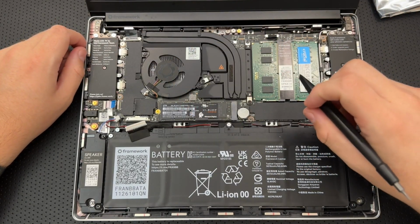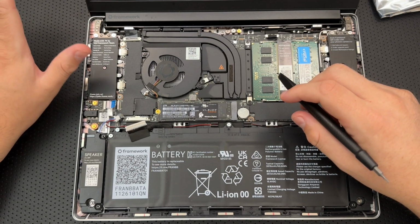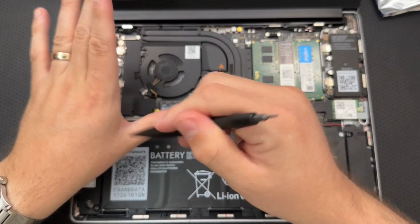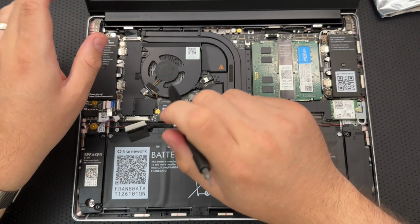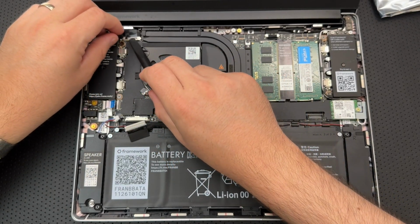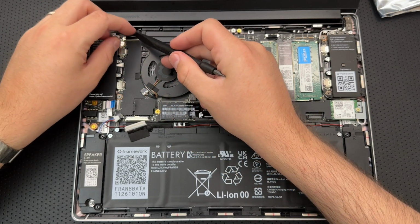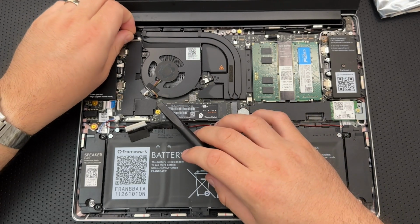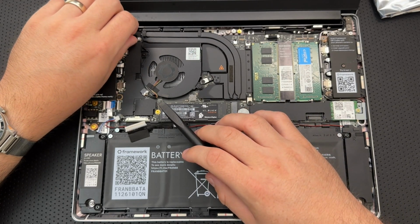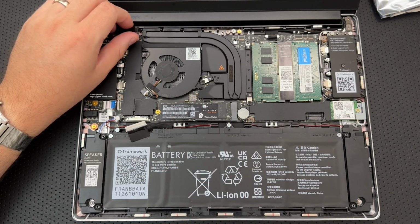Okay, disconnect the display from the main board. All right, using your fingers, disconnect it from the top left-hand side. This is my left. You can tell because it makes an L. By using the pull tab to pull it upwards. Okay, so that must be the pull tab. Is this a pull tab? Or is this whole thing the pull tab? Well, that worked. All right, easy enough.